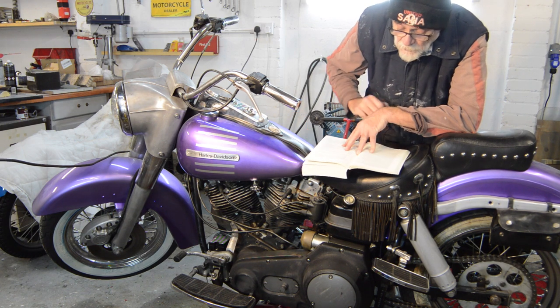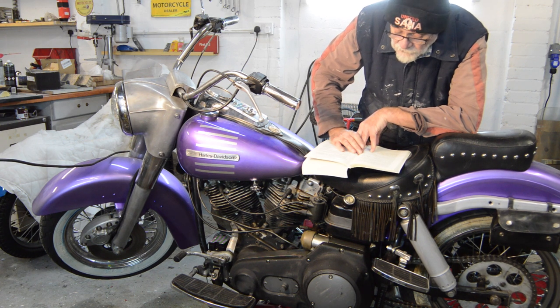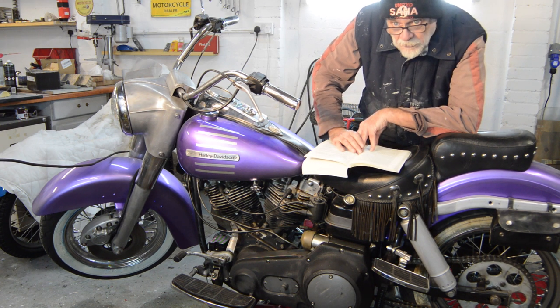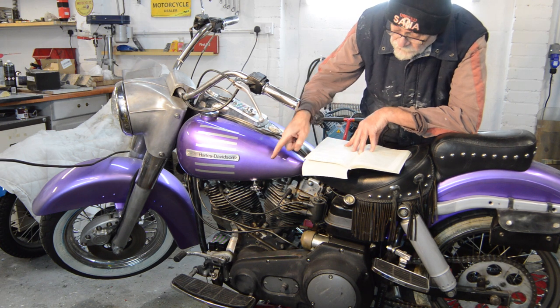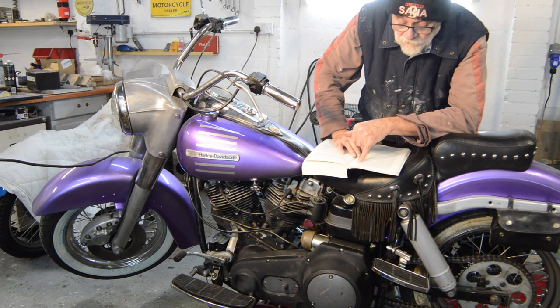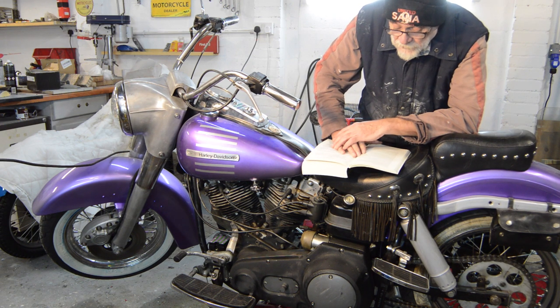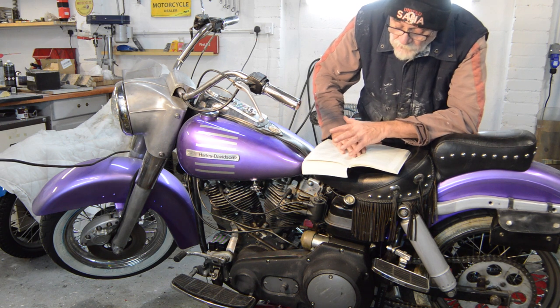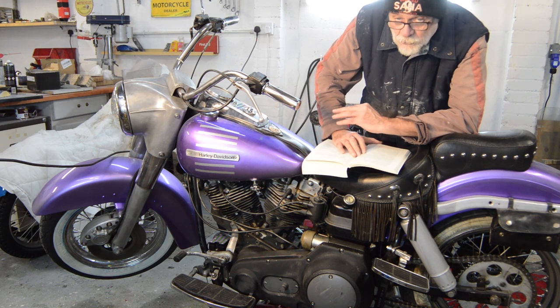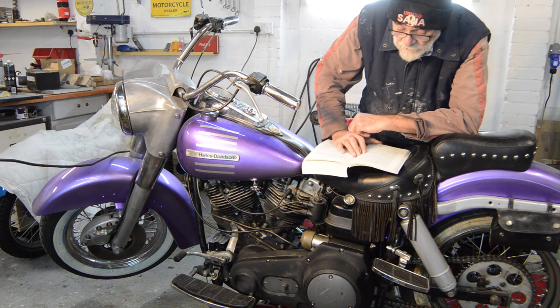Harley riders of the day used pry bars, tube extensions, etc., to try and tighten it up as they could. We didn't have enough money for compressors and impact guns, but they are the easy way. So, bearing in mind that I have got a compressor and an impact gun, I just chatted it up with that. It's a Snap-on gun. He says he generally tightens them to 250 to 300 pound foot, which is about what the Snap-on gun will have tightened them to. He also says it'll make an awful noise if the nut starts coming loose, so you get plenty of warning if you haven't done it up tight enough, which frankly is good enough for me.